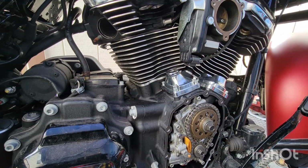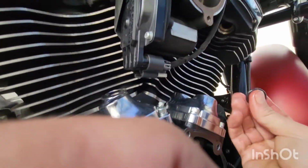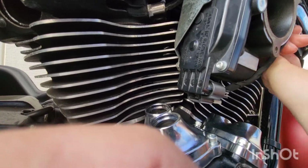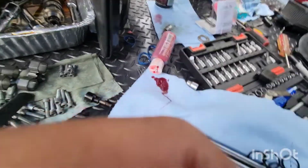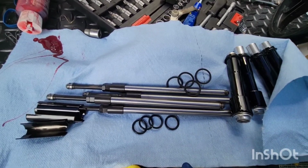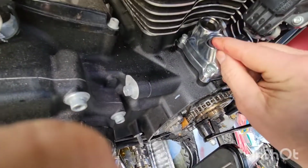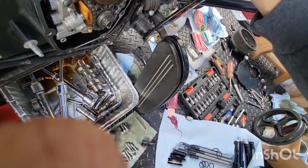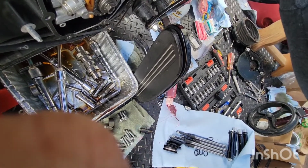Alright, now we can do the quickie push rod time. Alright, the thicker of the washers, a little lube, the thicker of the washers go back up, and the ones we just took out. So this one right here, it's stepped up in there, so it goes up to the next step. So these are in. Now, oh my Lord, the camera. The largest one was in the bottom here. So I'll put these in. The middle sized one will be what we put the push rods together with.